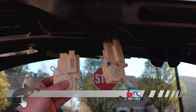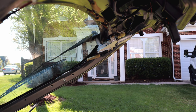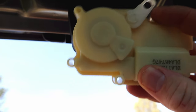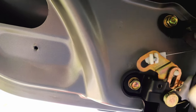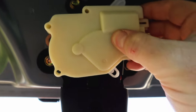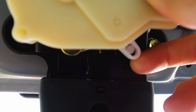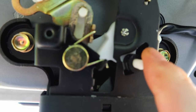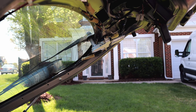There's a new part I ordered from Amazon, and I'll put a part number up on the screen in case you need to order it. I'm going to plug in the new part before I bolt it down, just to test it. Here I'm putting the part up against where it bolts, and you can see how this little white lever piece goes over this round latch. That actuator actually moves that latch — this is how it actuates either the lock or unlock mechanism by moving that little white plastic piece.